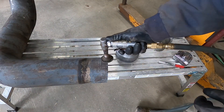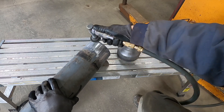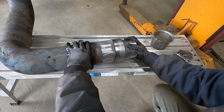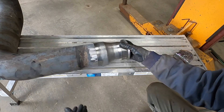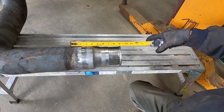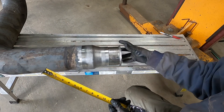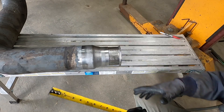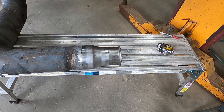Just going to clean this up where I'm going to be welding it. I'm just going to assemble it. I said we wanted it nine inches from the center of that clamp — look at that, it's about perfect. Because of this wiggle, what I'm going to do is bolt this all back in now, tack it, then yank it out and weld it.